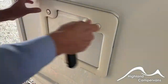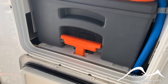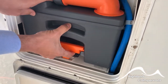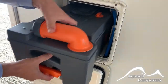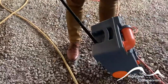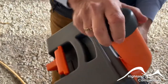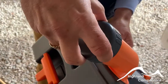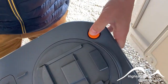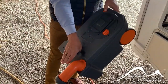At the back you've got your toilet cassette. Unlock and you have a large orange T-shaped lever — pull up on that lever, making sure that the cassette valve is shut inside first. The cassette should come out easily. There's a grab handle and wheels if you want to pull the unit across the ground. At your collection point on a campsite, remove the grey cap completely, tip up, and press the orange button at the top — that allows airflow into the cassette and allows the waste to come out of the bottom.